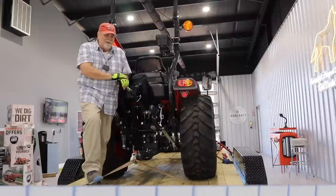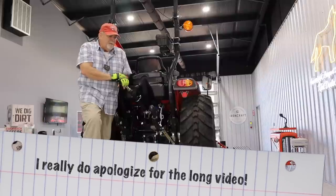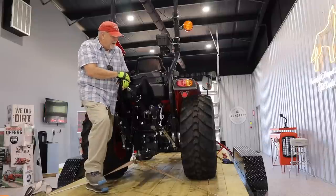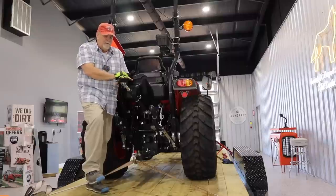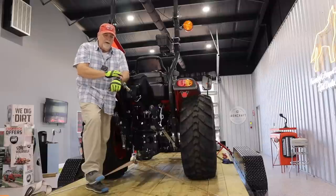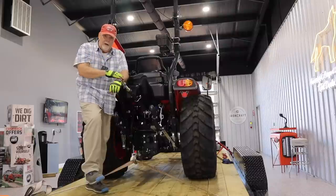Lastly, and I hope this is lastly, hook your truck up and run a light check. If you're by yourself, so be it. Do it. Check the left blinker, the right blinker, put a stick on the brakes and make sure you have brake lights, things like that. And then pull away where there's a big safe area and put on the brakes. You'll feel the difference if the trailer brakes are helping or not.